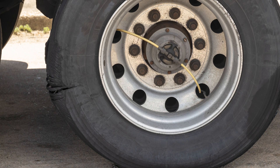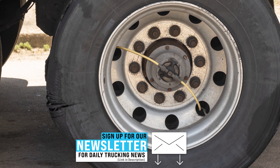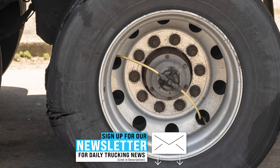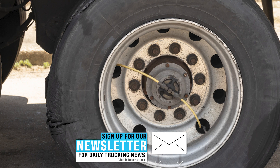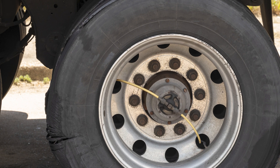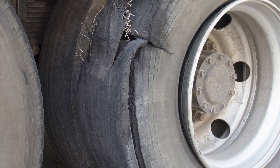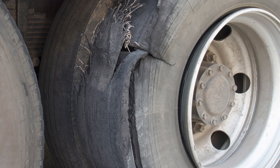Bulging is usually your first sign. If you've got cracking in the sidewall, that tire is probably aging out — it typically takes two to three years to develop that type of cracking. If you're checking air pressure regularly, at least once a week, you'll start seeing whether the tire has deflection. Deflection leads to bubbles, typically starting in the sidewall at the upper shoulder or near the bead — the two most vulnerable areas. Once you see those, the tire is done. There's no bringing it back; the damage has been done. It needs to be removed from service promptly, and no retreading or repair process will help once it separates or cracks like that.